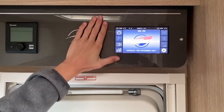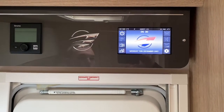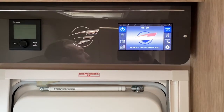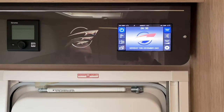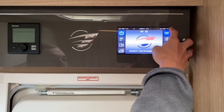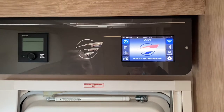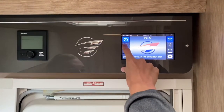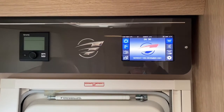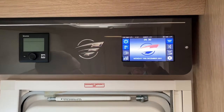Inside the vehicle, this is the main control panel above your habitation door. This does everything from electric to water and your water pump settings. To turn on, press the on button — this will either give you 240 volt so you can use the normal three-pin plugs, or 12 volt if you aren't hooked up. Up here you've got your interior lights — they are all individually switched but you must have the master switch on. It tells you the internal and external temperature, and there's a little lightning bolt indicating you are hooked up. Underneath the on button you've got the water pump — put this on to supply your external shower, internal shower, toilet, kitchen sink and wash basin. The pump must be on to push water around, but only turn it on when you've got water on board or you will damage the pump.